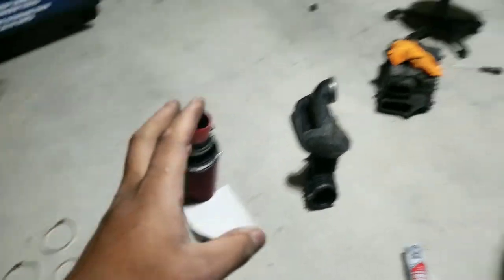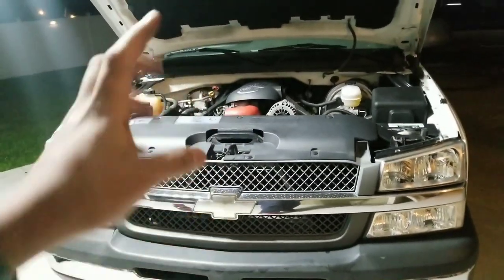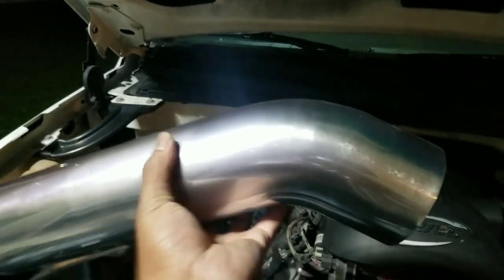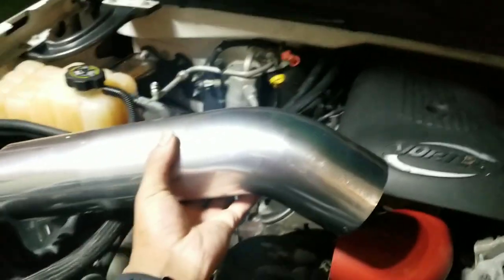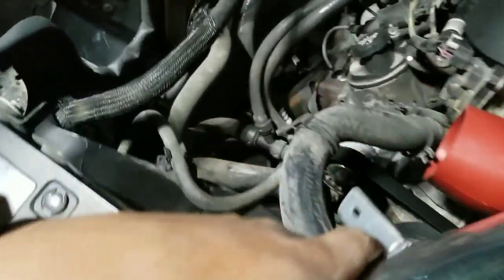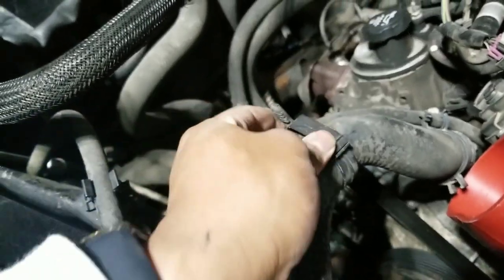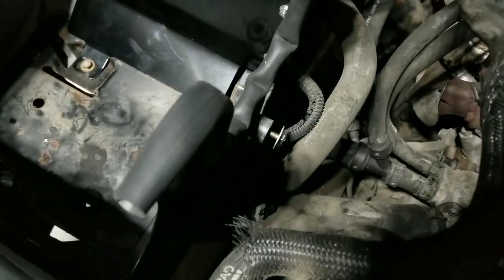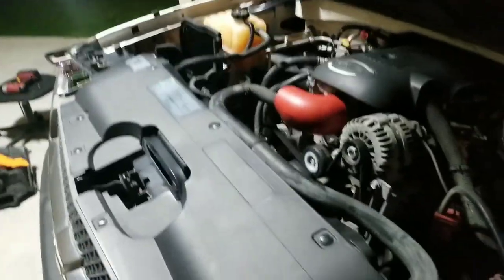That's the gist of it. I'm about to go ahead and throw this in and we'll be just about done. I'll give you guys a startup clip of the first startup with the new intake on. When you put the intake pipe in, the curved side goes towards the motor. This little piece right here will clamp on — you push it through and the long piece on the intake will go on the vibration mount coming off your air box. You can see that little stud coming out with the washer and rubber isolator — that's where the long piece connects. I'm going to put you guys on time-lapse and we're going to finish this project up.